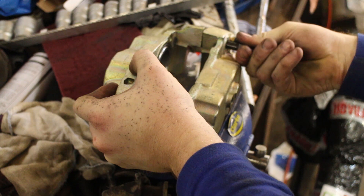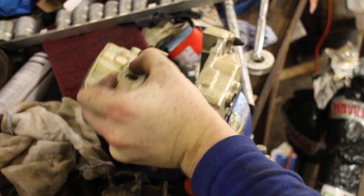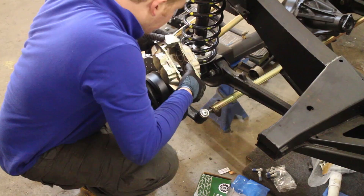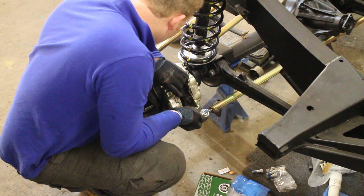However, splitting the caliper does make swapping pistons and seals so much easier. If you do this, it's of your own volition — there's no torque setting for those bolts since no brake manufacturer recommends this. Here are the stainless steel pistons; we're fitting these because we do such little mileage that they often corrode. We're using red rubber grease for the seals, which also helps the piston slide in easier and should prevent water ingress from the hygroscopic action of brake fluid. Press the piston in with your fingers or lightly in a vice, and repeat for all pistons. Refit with the bleed nipple at the top; the bolts are bi-hexagonal so you'll need bi-hexagonal sockets — a 10 half-inch socket set works really well.